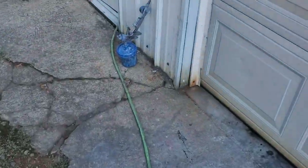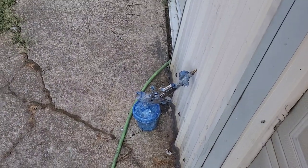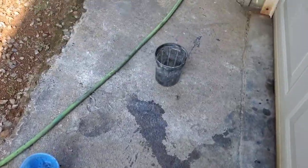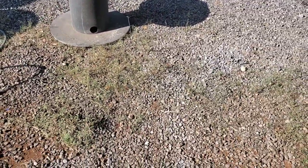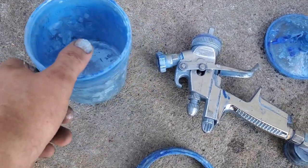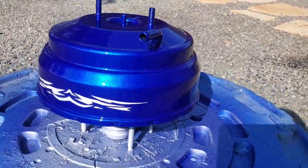I'm gonna give this about 10 minutes out here in the sun and mix up some paint while I'm waiting. I did run out so I'll mix up the same amount and we'll hit it one more time. As long as we don't have any runs, we're good to go. I'm gonna tell you something — whenever you get done spraying and you think you've got it right but you've only got just a little bit of clear left and you want to spray the rest on your panel, do not do that. Just take it off and throw your clear out in the trash — save yourself some trouble. I have done it and I have failed. You will get a run.